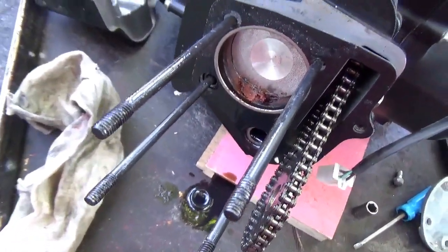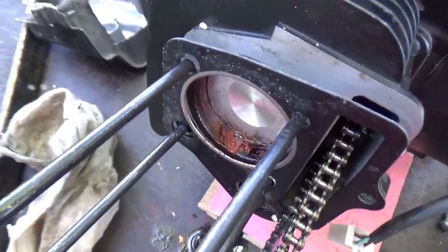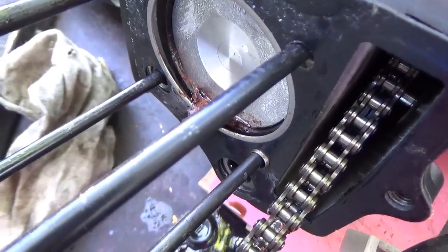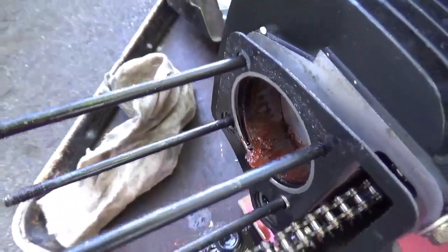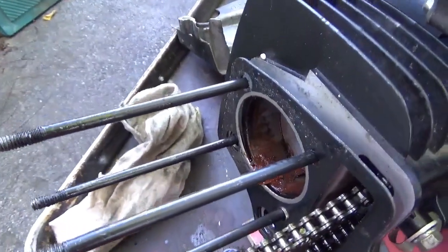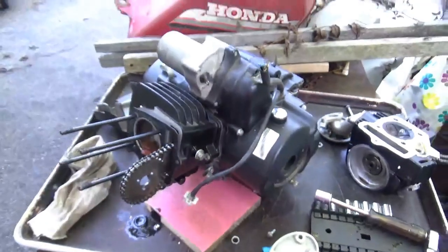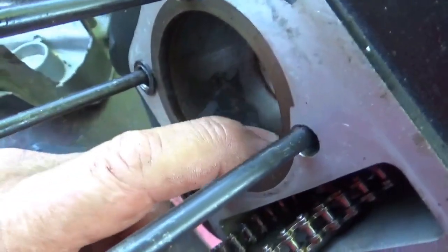There's a little bad news with the piston right there. Let's get access to the crank and see what we can do with it. Yeah, it still turns. I think I'm just gonna wipe the bore out, clean it up, make sure the timing is good, and see if this thing turns over - check what kind of compression it has. This might be a 100% winner for a $40 engine, this might be a bloody home run.